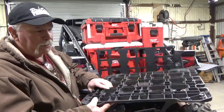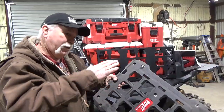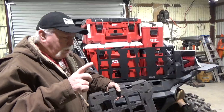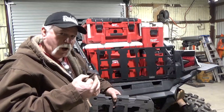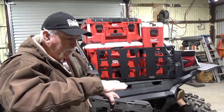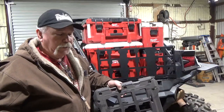They have the honeycomb — they're pretty stout, and this probably would not do anything — but I'm worried about the machine. Drilling holes and putting it on the plastic. Some of these guys put some serious weight on these. When you're working that on that plastic and you don't have a good frame mount, you're taking a chance on cracking that plastic. On my installation videos, when I take the D-ring bolts out right here, I tell you there's a silver washer down there — you must leave that in there. It stops whatever you're tightening from grabbing hold of that plastic, so the plastic floats in there. If you lock it down on one of these, you're taking a chance on maybe cracking it. It might last forever, but anyway.